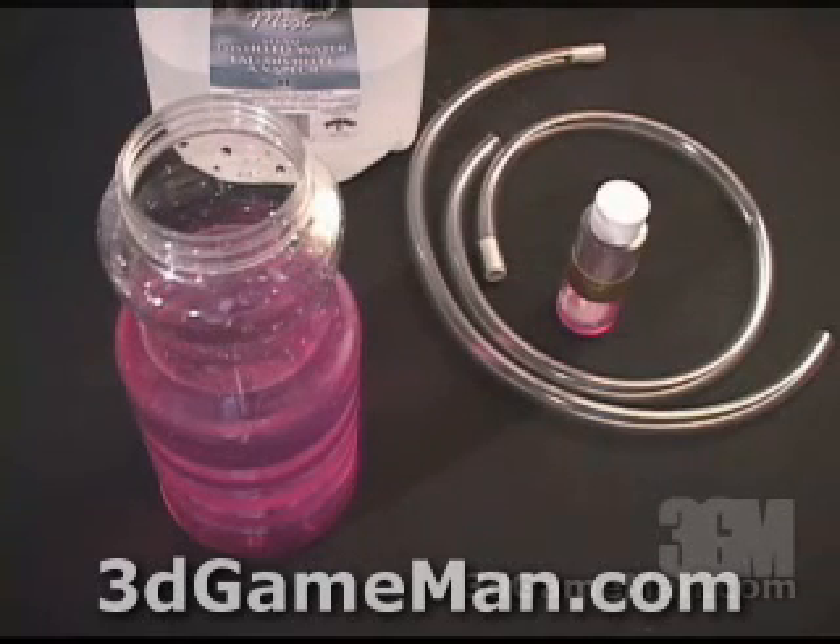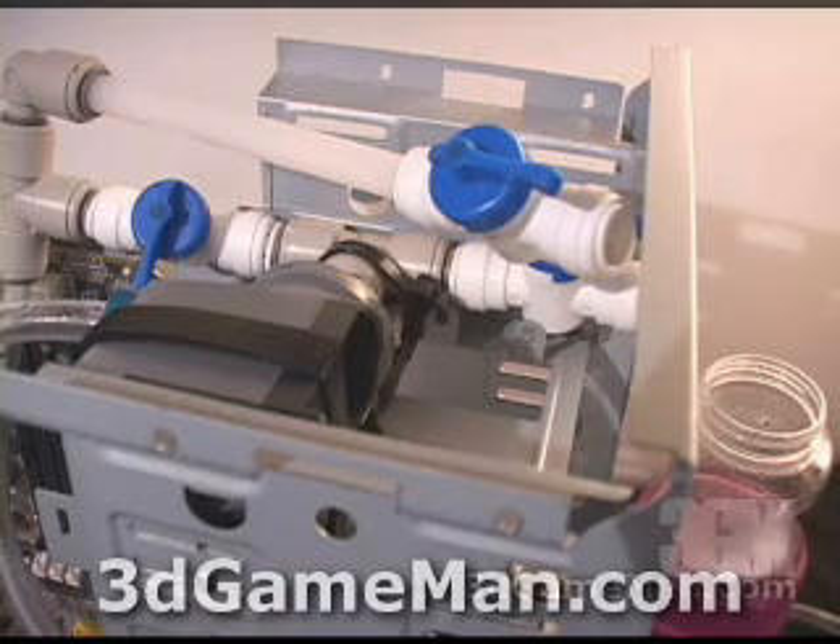Pour the coolant into one liter of distilled water and then proceed. There is also a way to test the circuit without using liquid: close the main valve, connect the two pre-cut tubes to the inlet and outlet of the fill and bleed kit, open one valve and close the other, then suck vigorously on the open line to create a vacuum. If the vacuum persists, the system is airtight and therefore leak-proofed.